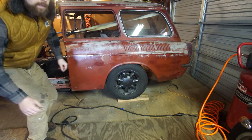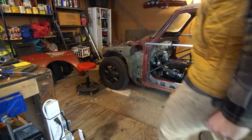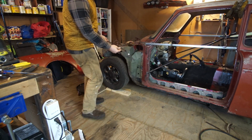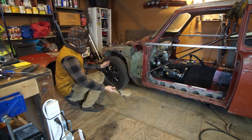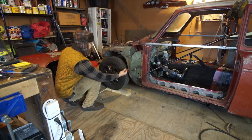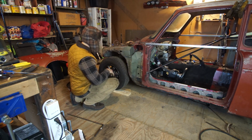So that tells me that I really gotta put on the front fender. And see, I was using this here, and I did some measuring and I made this long enough and I welded it right there. And the tip of it was supposed to line up with the tire, and it does, it lines up with the peak of the tire here. That's how I got the vehicle forward and backward where it needed to be.